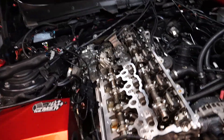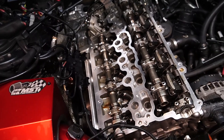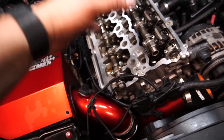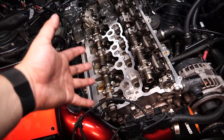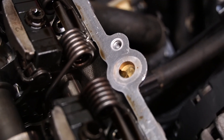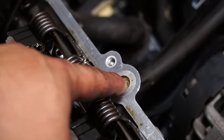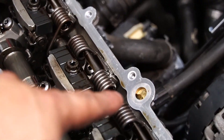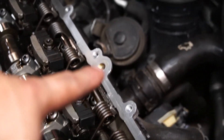All of this area was filled with oil, which could be normal, but in my case the PCV is shot and oil is going everywhere. What I want to show you are these ports right here — this is where we're going to be tapping in order to plug the head ports. On the B58 there are three ports total. On the N55 they were all individual, but here we have three — one, two, and three — and if we look deep in here, we can see there are actually two ports per group.